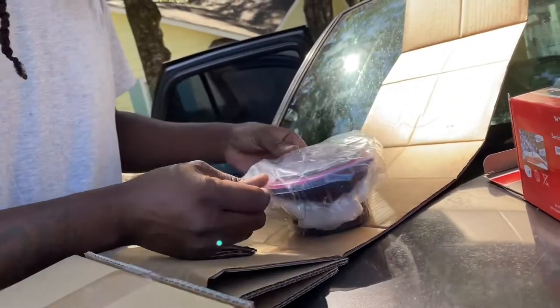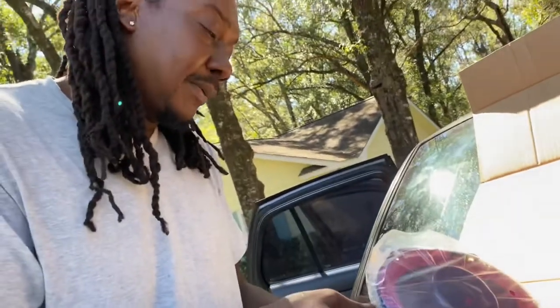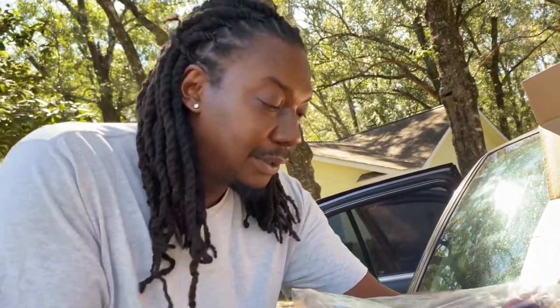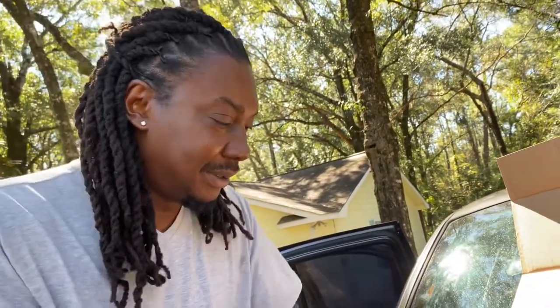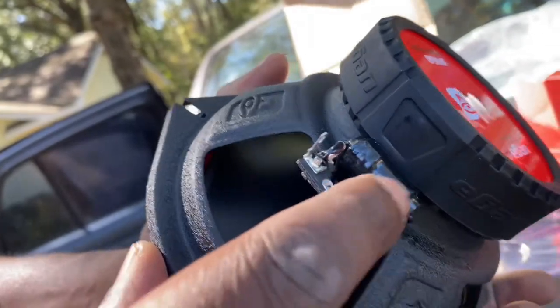This is the speaker. Now, from the picture online, I think they come with bass blockers. If they do, the audio shop normally wouldn't tell y'all this, but if you got a very powerful head unit and you put some bass blockers on your speakers, it'll sound real good and real loud without blowing them. But they prefer you to buy amps separately for your interior speakers. You know, everybody gotta make the money though. But I did it before and it sounded great. It was screaming. You won't get mids out of them, you'll get straight highs though. But you got bass in your trunk, you really don't need bass cutting through your inside. Yep, I think that should be the bass blockers I was telling y'all about that come with them.